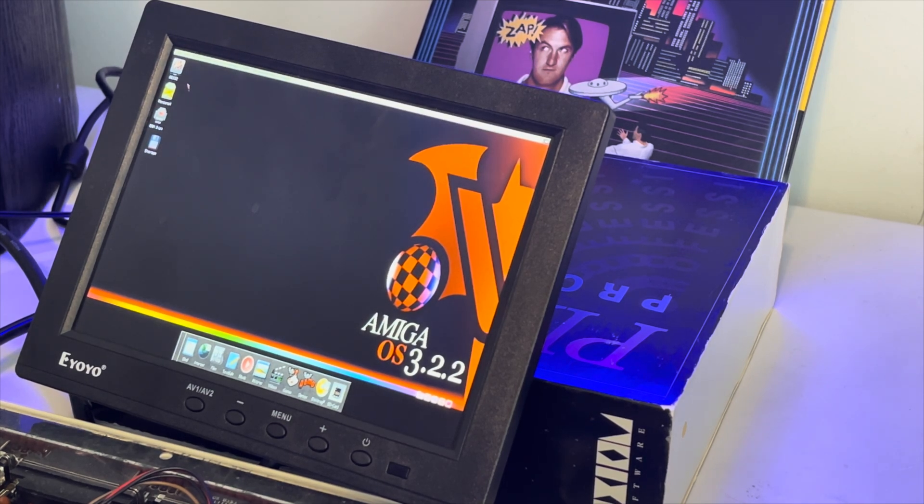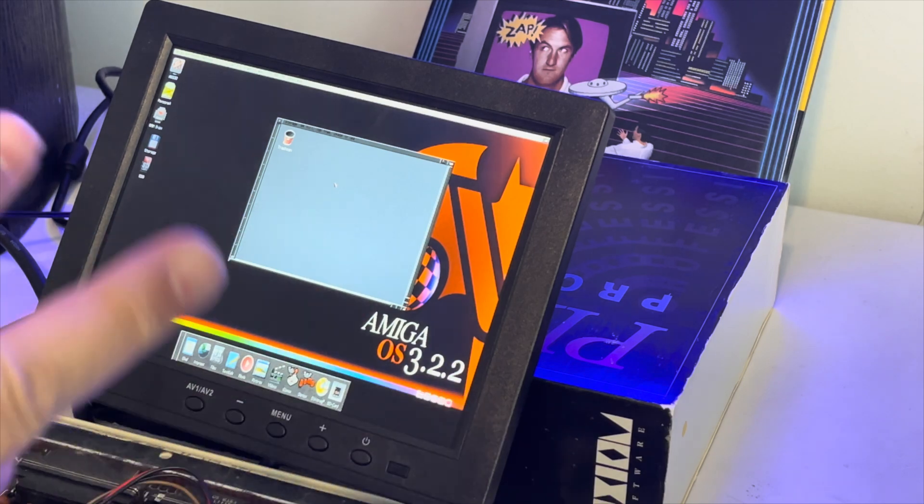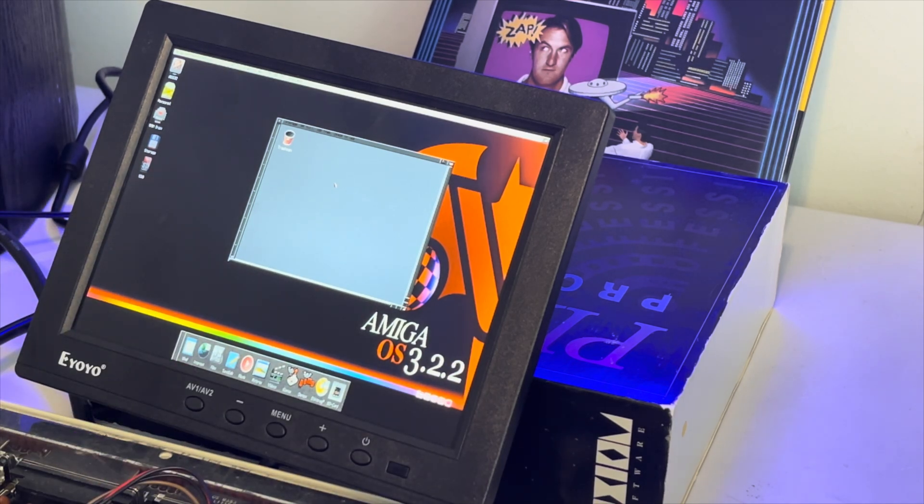Let's do the first test. We've got this microSD card — we're going to hit the button down here and watch. SD0 pops up. So we've got my storage partition. When you go onto the website, register, and get the operating system collection installed, it's going to generate a single hard drive partition like a DH0. In my case it came up with an SF0 partition, which is one of the newer robust file systems.